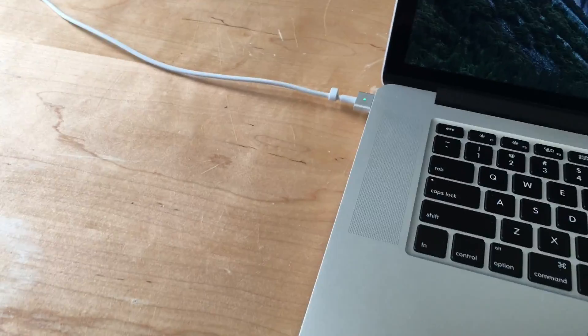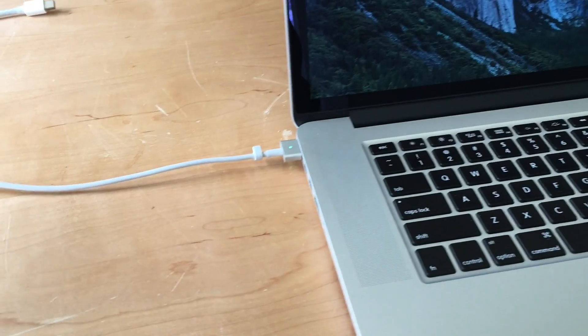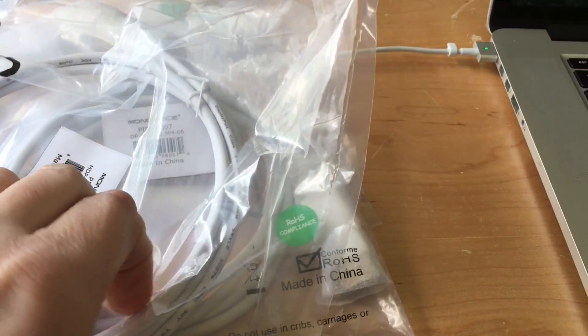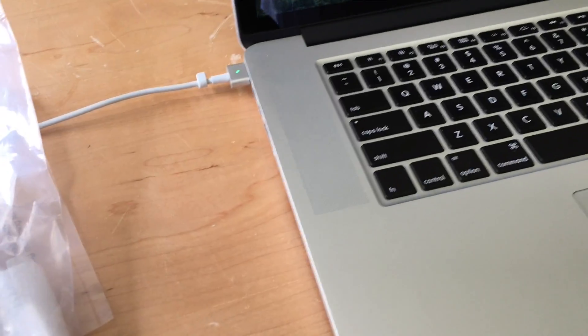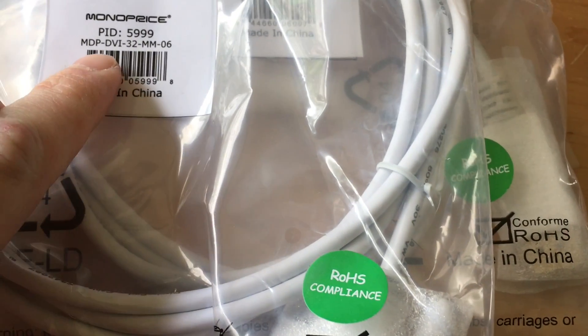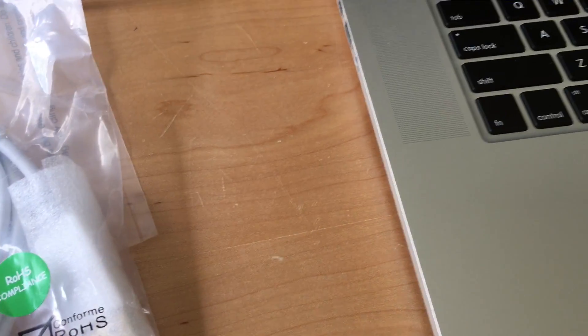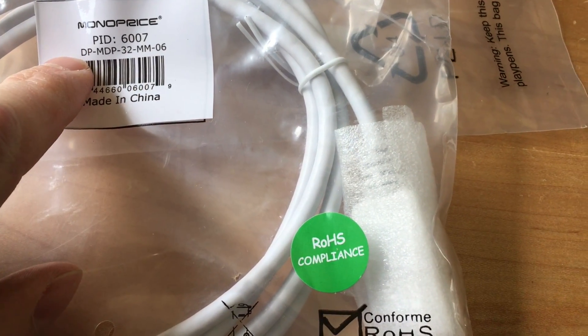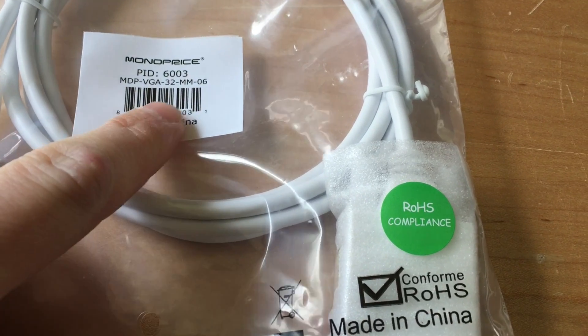The option that I like — you want to check out a company called Monoprice, and I'll put links in the description below. Monoprice makes cables that will directly connect to your monitors. These are mini DisplayPort cables — they have a mini DisplayPort connector on one end and then the connector that will go into your monitor on the other. I have three different cables here: a mini DisplayPort to DVI, a mini DisplayPort to DisplayPort — we'll talk about that in a second — and a mini DisplayPort to VGA.